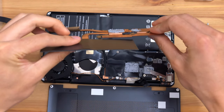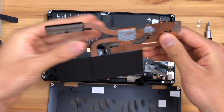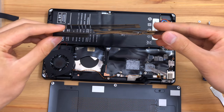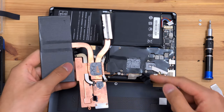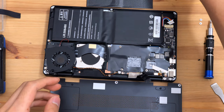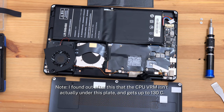It's already a little bit bent out of shape, so we'll have to fix that before putting it back together. It really is a thin and fragile cooling system, but an effective one. With the default thermal paste — which is quite excessive — it still only gets up to about 73 degrees Celsius under about 14 watts of load.